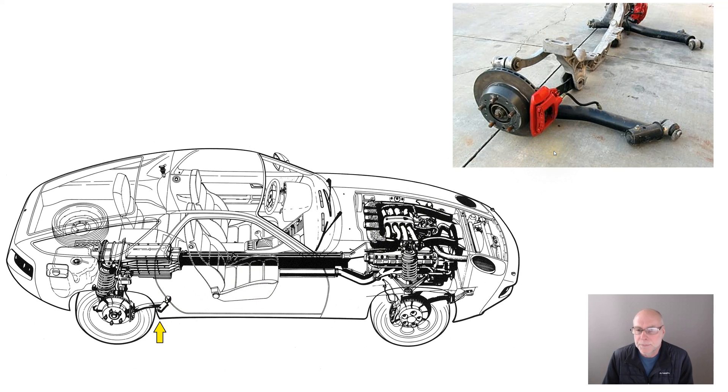And if we look up here at the suspension out on the ground, we can see there's that little link which is arrowed, the long link, and then there's two transverse links. That lower transverse link has a flat plate which is able to twist. It's this long forward link that we're interested in because that's what controls the toe angle of the rear wheels.